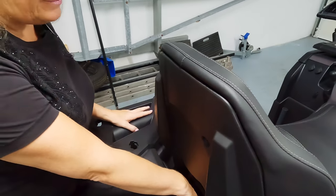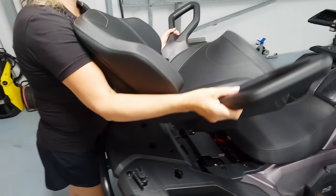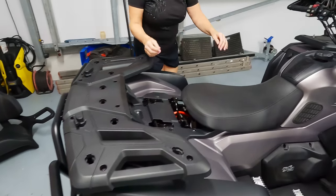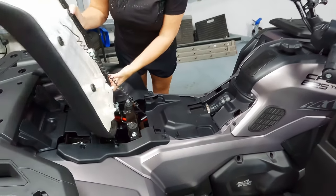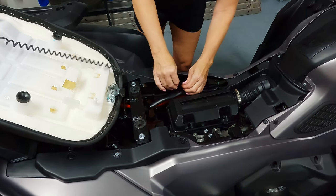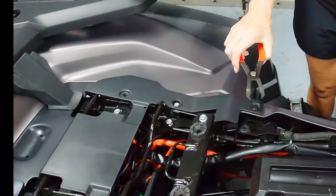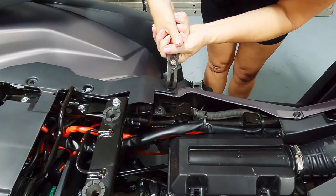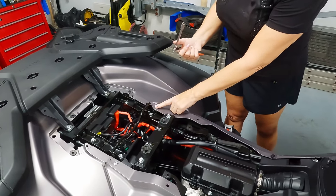Pull the handle at back of the rear seat, which is here. Two hands because I'm a girl! There we go. The seat is up — it's quite heavy. And the front seat, the little lever is here. Just click that. Be careful with this because you've got a wire for the seat sensor attached that has to be undone first. Just pop this cover off. This is a special little tool we've purchased to be able to pull the pins without damaging them — all four of these pins here need removing.